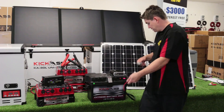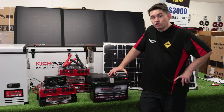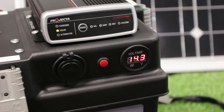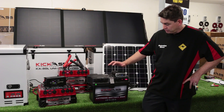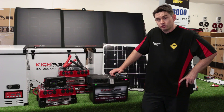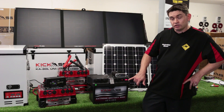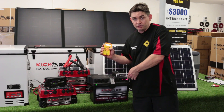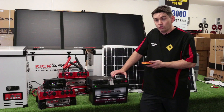The next thing we need to check is if our DC-DC charger is working — so charging from the car. Whether you've got an isolator or a DC-DC charger in your vehicle, you need to check if that's working properly. In the case of a DC-DC charger, your voltage when the engine's running should be about 14.3 volts or a little bit over that if the battery is fully charged. The DC-DC charger will boost the voltage from your vehicle to properly charge your AGM battery. If you have an isolator, start the vehicle and check the voltage — you may need a multimeter if you haven't got a display on your battery — and that way you know your auxiliary battery is being charged either by a DC-DC charger or by your alternator.